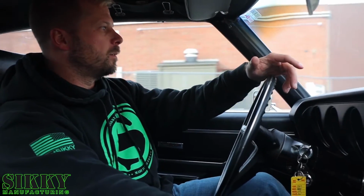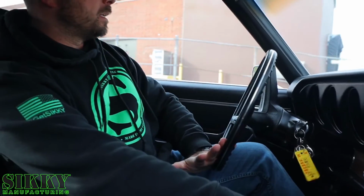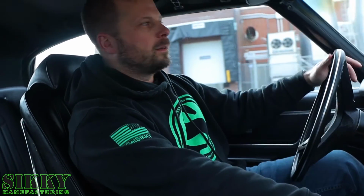That's the end result of doing the drivetrain swap to something modern, we're putting a lot of reliability in this thing, where these old carbureted motors, you go out to it on a really cold day and it might take forever to warm up, run like crap. Then on a hot day, it's the opposite, and you've got other issues. So for consistency, modern fuel injection is a no-brainer these days, and it just smooths all that out and makes it super reliable and much more mellow.